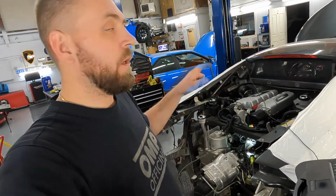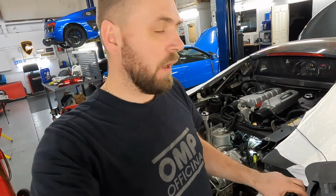Next, I would like to install the exhaust, the rear end. And then I need to perform a test. Because after any clutch replacement, engine swap, transmission replacement, doesn't matter, you have to relearn the point initial slip, PIS. It's really important to explain what the clutch thickness is and how the hydraulic system and all sensors can know what's going on and what needs to be done. It's really important for clutch life.